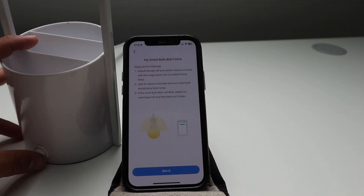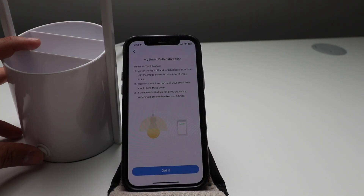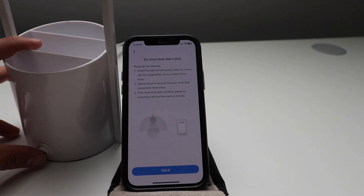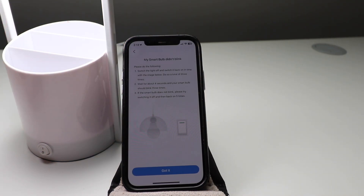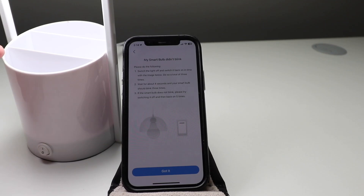We'll show you that real quick. We're going to do this three times: it's off, on, off, on, off, on, off — and then turn it on and leave it, and it should blink in four seconds. That's going to trigger its Wi-Fi signal to go back out. You saw it blinked, so now go to that Wi-Fi network and it should pop up there. If you're having issues getting the Wi-Fi network to show up, do this procedure to get it showing properly on your phone.